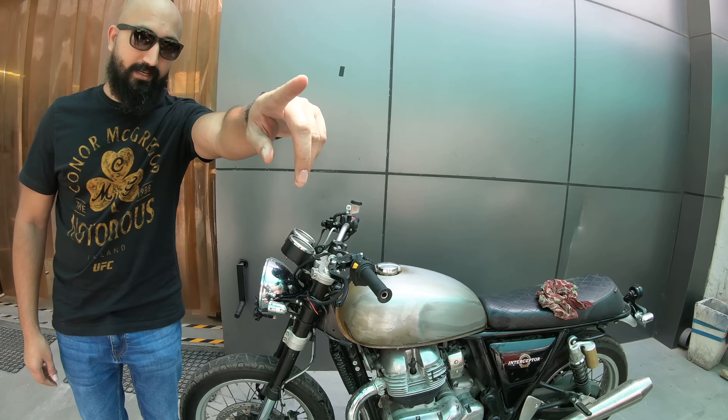The ABS works on this bike. If you could see here, there's a little disc behind the rotor and the hub. We had to create it so that the rotor fits into the brake caliper, which is in a fixed position. We can't move it, considering it's radially mounted and there's just no way to move it left or right. We also had to create space for the caliper so that it doesn't touch the spokes.